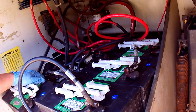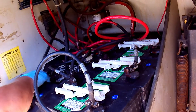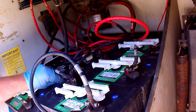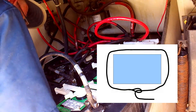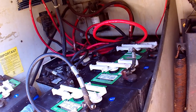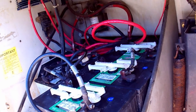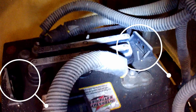Removing a battery from any vehicle can be a real pain. If the battery is in a box, it's more so. These batteries are very heavy and in this case they don't have any handles. But with a length of strap, I can make a handle that allows it to come out without much pain. Tie a loop on one end of the strap, wrap it around the battery, and pass the loose end through the loop. Pull it tight with the loop at the middle of the battery, and use the loose end as a handle to lift the battery out. For very deep boxes, the strap can sometimes be wrapped around the terminals, or used to form a handle using the lift points molded into the top of some batteries.